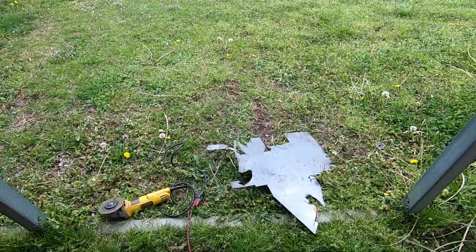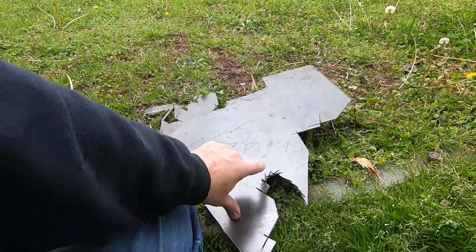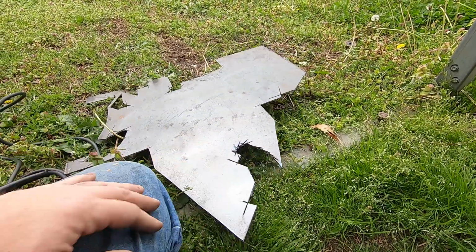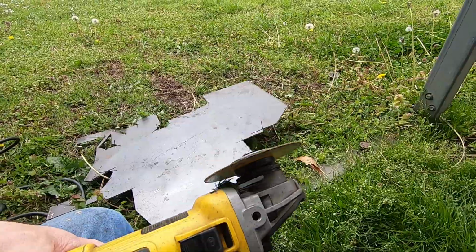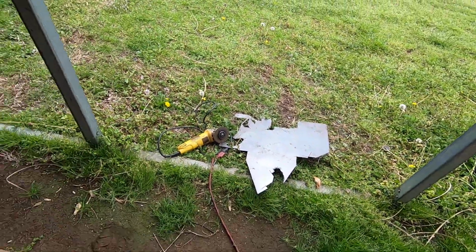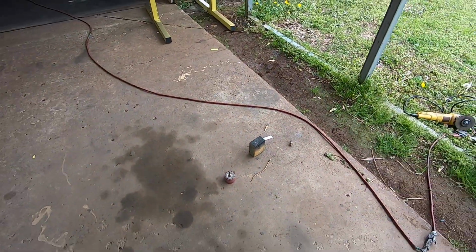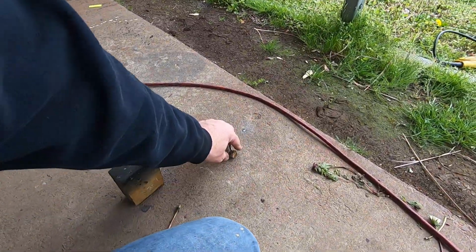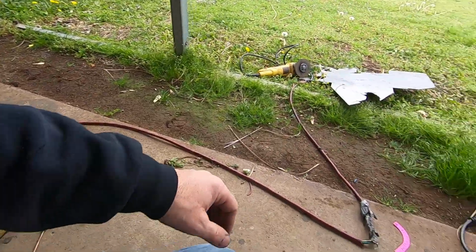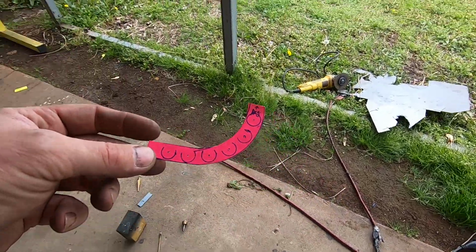This is just an old crappy piece of hot rolled steel I had here. This is like 1/8 inch thick, and you can see where I cut it out here. I actually cut both of them out. I cut one out here and one right beside it, but I used that to cut it out with, and then I finalized it, you know, cut it out a little big and then finalized it, smoothed it up and edged it, and used a barrel roll on the inside curve. And I drilled the speed holes in it with a step bit, and then I used a countersink bit to get them chamfered a little bit so they kind of look like a dimple die in a way. Here's actually my template right here for the bottom piece.